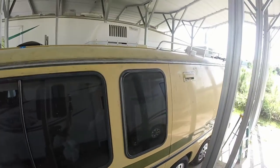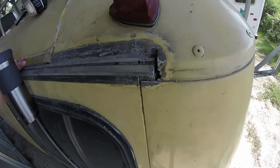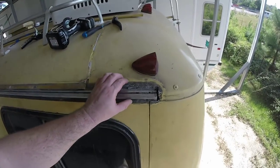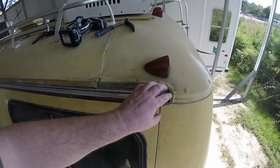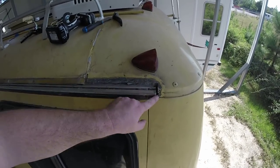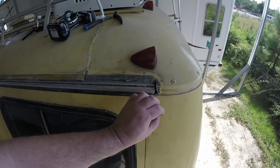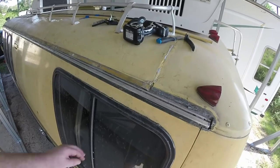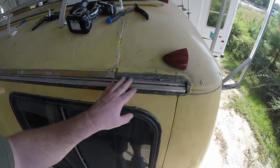It's looking good. The end caps is where you have a lot of the problem. The long rail up here goes and stops about here, and then there's a little side cap that has one screw where three pieces come together. A lot of people will just take off this end cap, fill this little hole, and silicone around the top and be done with it. That's probably good for the first 35 years, but at some point it needs to be redone — and this one was to that point.